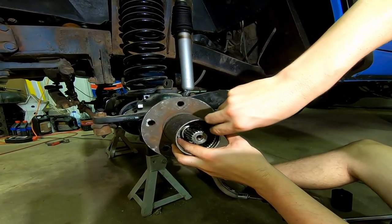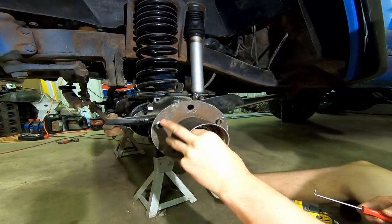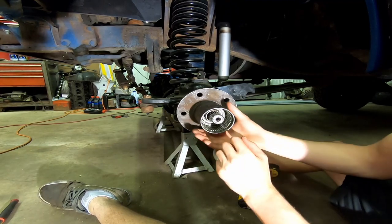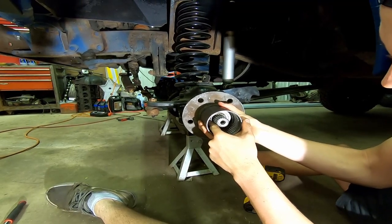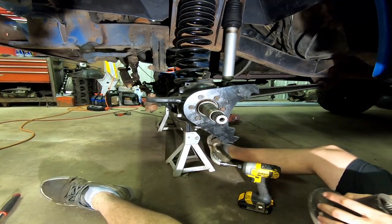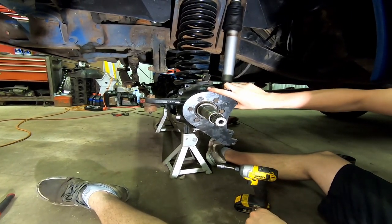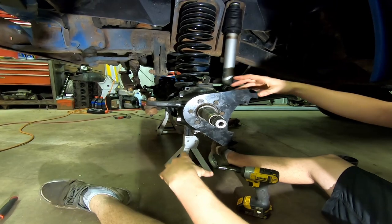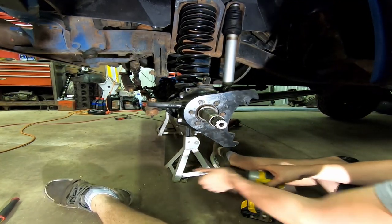That's what it was for me on the other side. I'm going to do this struggling off-camera. From this point, after I get those spindle nuts off, there's going to be a bearing right here that's going to come out with the spindle. Make sure that you have those bearings, if you're going to actually use them again, to not drop them everywhere. I'm pretty sure this bracket here will actually be the bracket for the brake drum backing plate - instead it's this setup that was not right, but it is what it is.